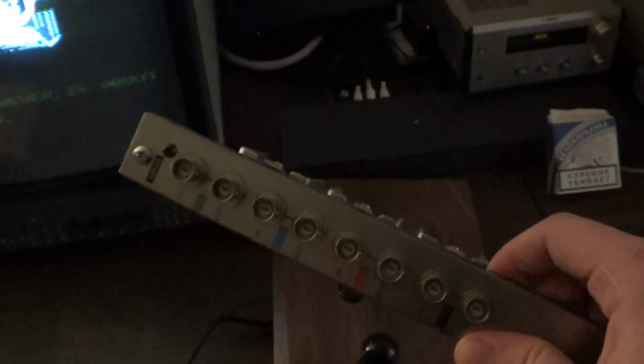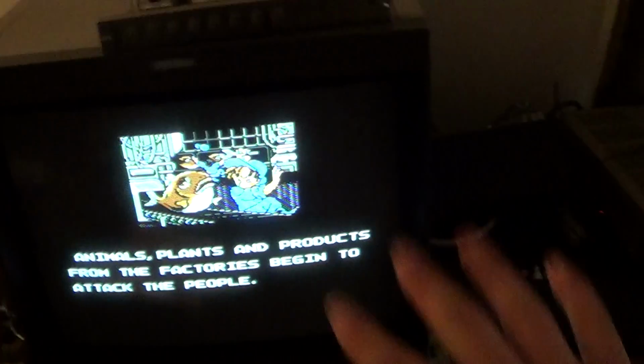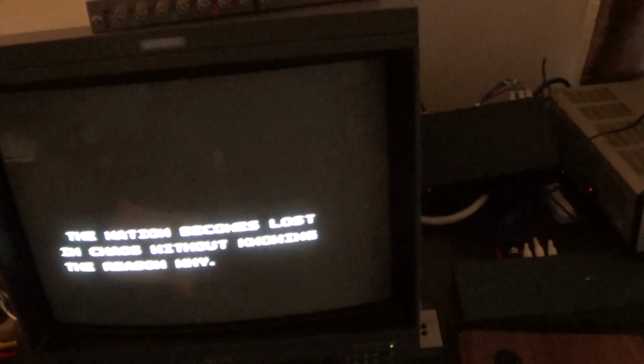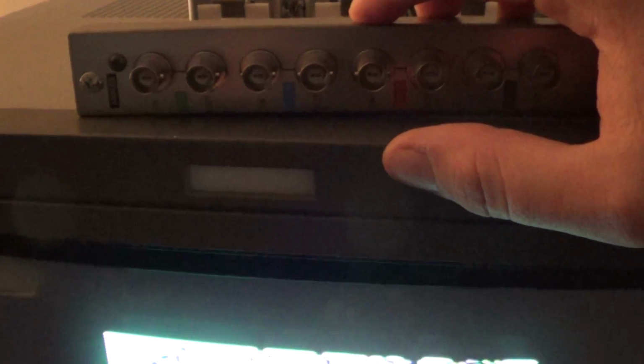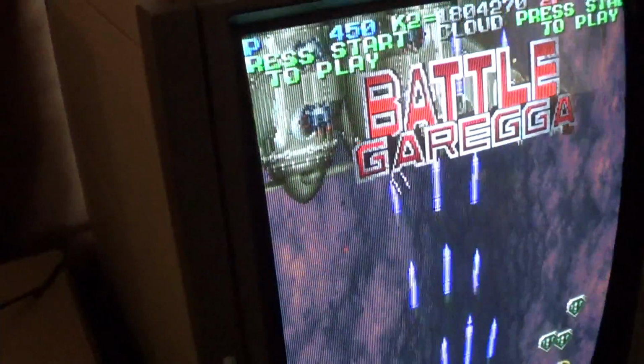So these were very professional grade monitors, so they didn't want anything coming loose all the way in the back, because I guess if you're at a television studio or film studio, you might have a bank of these, I don't know. And so you don't want anything coming loose. And these also, you see all the inputs are doubled up so that you could actually have them satelliting out to a different television. So one thing about this is, this is RGBS input. So this is your red, green, blue and sync. So each is a separate input, and that makes for an insanely good picture.